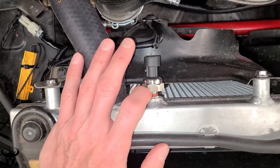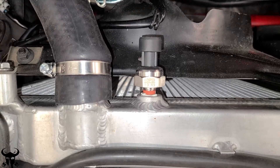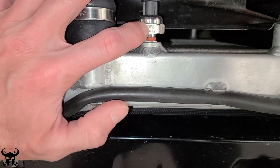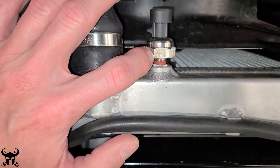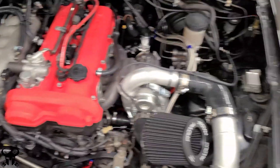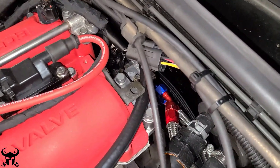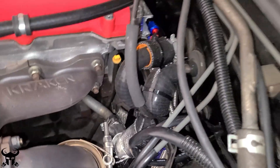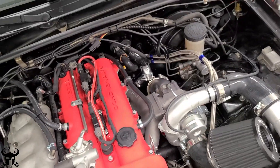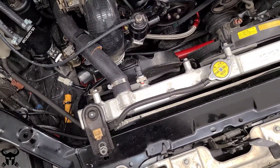The last few weeks I've been monitoring and tuning the car with my computer, optimizing the tune. But I don't want to run it like that all the time on the racetrack - I definitely don't want a laptop mounted next to me. I'd rather have gauges. This is a coolant pressure gauge I want to install. I'm also going to get a coolant temperature gauge for accurate coolant temp. The coolant temperature going into the Megasquirt is back here, and I might tap in there for a sensor. In the future I also want an oil temperature gauge and maybe a battery voltage gauge.